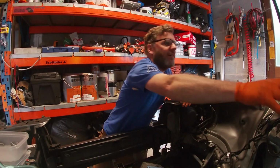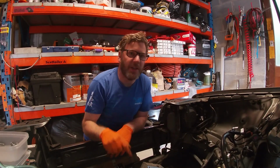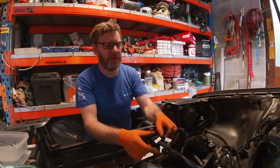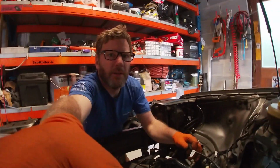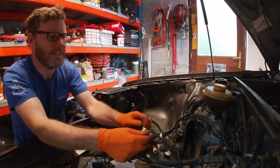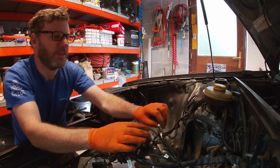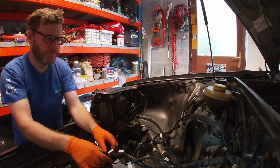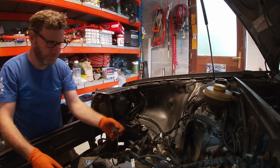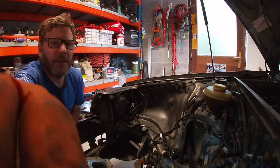Wiring, as I said before, I'm reusing. I'm going to put the VCU down where the ECU used to live in the passenger footwell. Since then, I've been mapping all the cabling. So if you look down here, I've mapped all these to the wiring inside, so I know that this is the idle speed valve, this is the cold start valve, what's that? Something else, idle switch, and here's knock sensor 1 and 2. There's a few other bits and pieces, so I can repurpose these